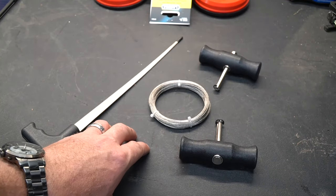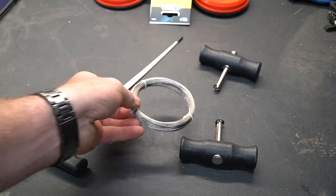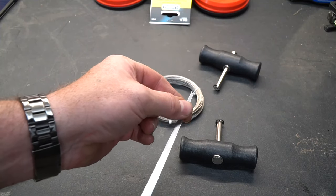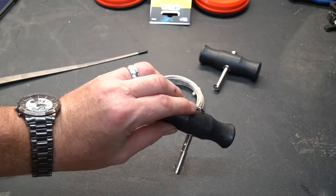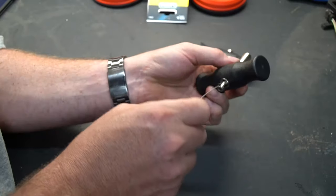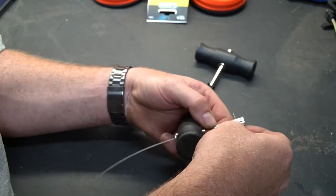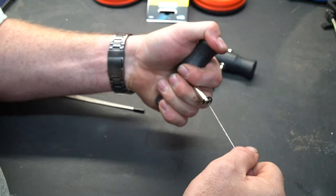Now let's talk about the second tool — the rope saw. It comes with braided cutting wire in a nice roll, and a starter stick. The starter stick has a fork on the end: you put a piece of braided wire in there and jam it from inside the windshield toward the outside. To set it up, cut a couple of feet of wire, run it through the handle hole so it comes out the side slot in the shank, thread it through the hole, leave about a half centimeter out, tighten it back up, and the wire is locked in with a way to hang on.